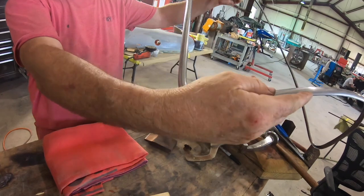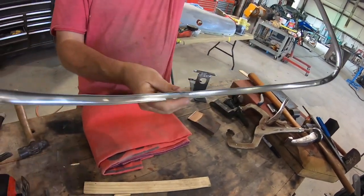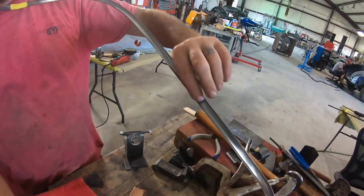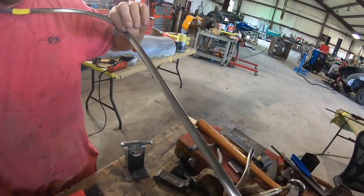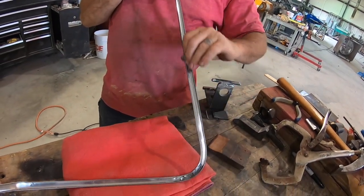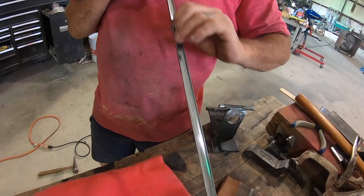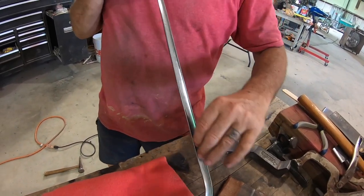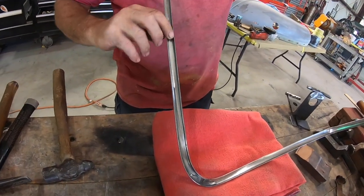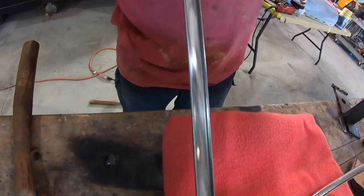Same with this side. One was really bad — this side was really bad. I've worked a lot of it. I got the roundness; if you close your eyes and just feel it, the shape's right. I've got a lot of little tiny dings to work out, and now I'll shadow cast it and sand it, then do the same over here. The feeling of it is real good now.